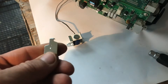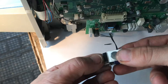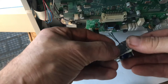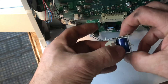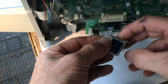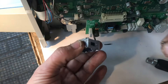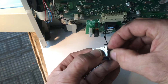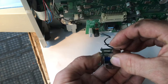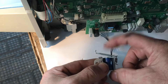I've cut a bit of insulation tape — three strips — put three on top of each other and stuck them on there. Put that back on top like that, and if you look down there it's all parallel. That doesn't stick now. Get the spring here again — be careful, if it pings across the room it's game over unless you can find it. There she is, on there. That springs forward — there's no way that sticks now, whereas before if I pushed it it'd stick.